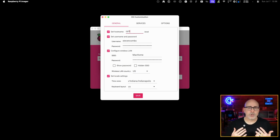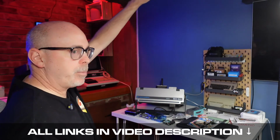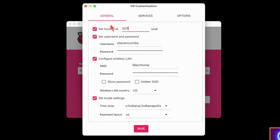Now, eventually what I will do is, once I get it online, I'll go to my, by the way, I have a new router. It is right here. This is a new TP-Link. I actually have two of them. I have one downstairs, one upstairs, so it's a mesh. And in there, I will assign a DHCP reservation for that specific device, so it always has the same IP address. But the nice thing is, you don't really need it when you set a host name either.